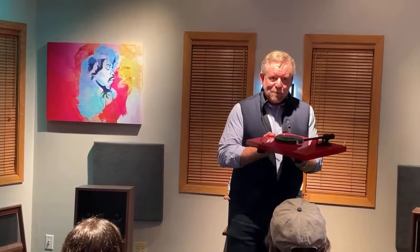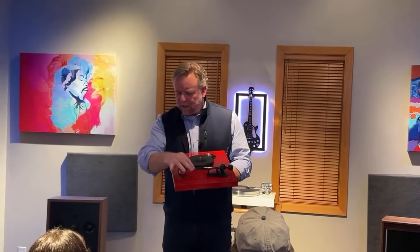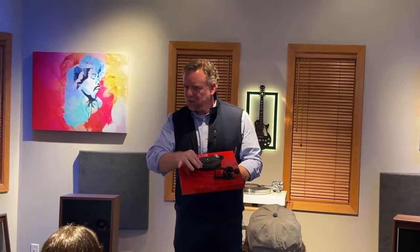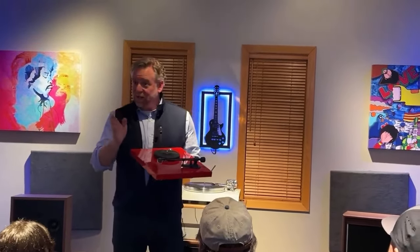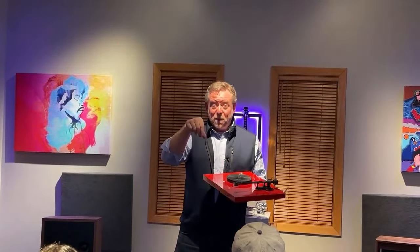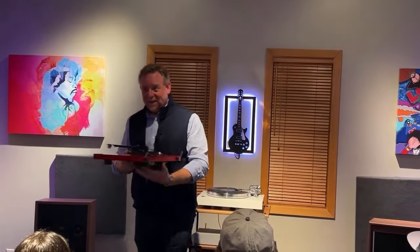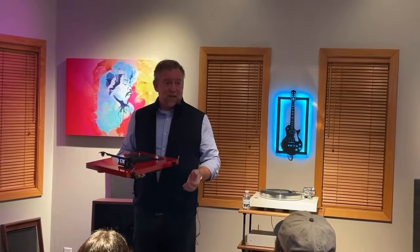And if there's any play inside that arm — I love people who come in and do a talk with me — first thing you do, go check another turntable: gently grasp the tone arm and just rotate it. If there's any give there, that means that tone arm, as it's trying to track the surface of the record, it's violently slamming back and forth into the walls of the groove, which on the microscopic level is terrifying. It doesn't look like much up here, but it's a lot. And again, that creates additional distortion inside the system.